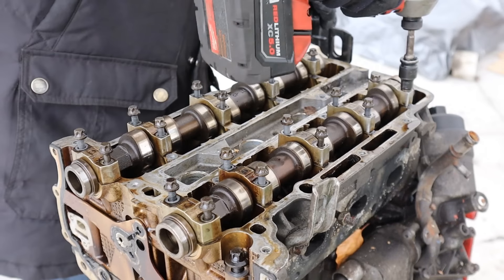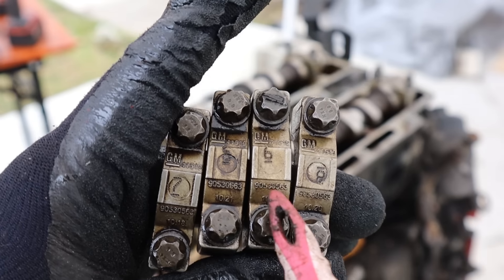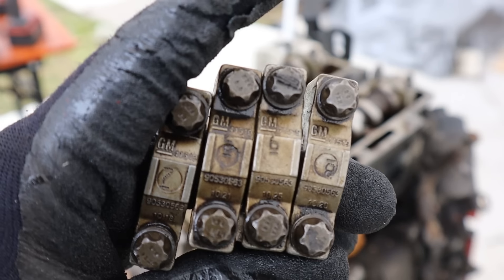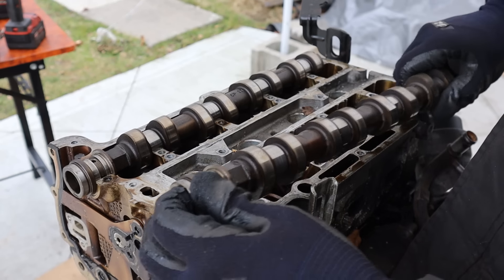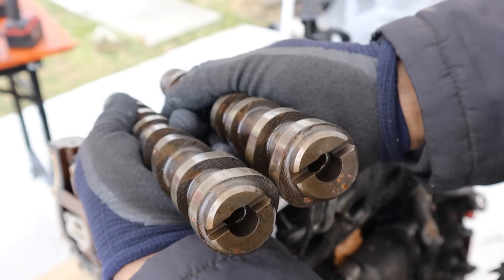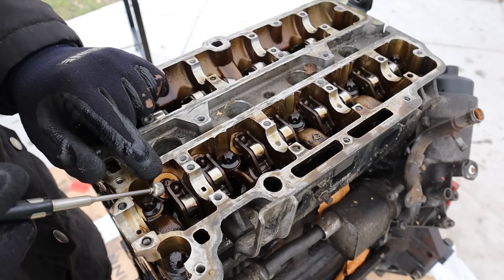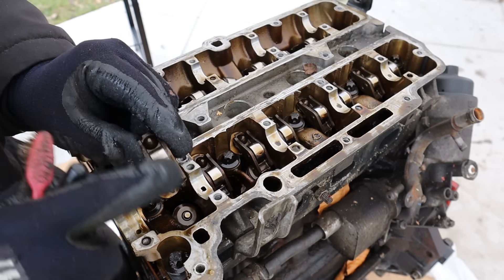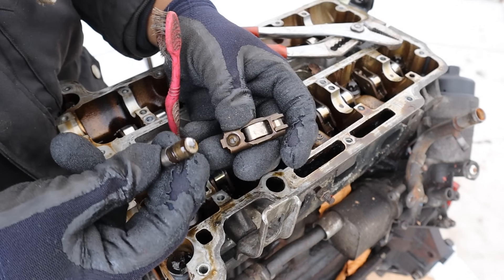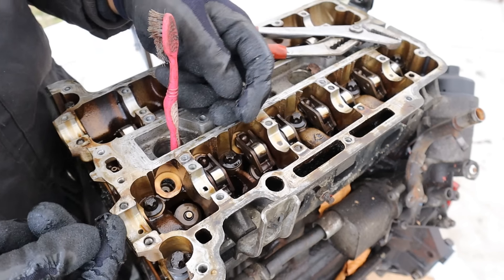Next up I'm going to remove these cam caps. Some of these have a bit of lines on them, indicating that they are worn through from all that coolant that ran through the system. It's interesting that GM stamps all of their little parts, even these little cam caps, with their logo. Now you'll see at the back here — those two slots are for when you're doing a timing job on one of these, and you put the cam holding tool in between there so they don't roll back. In this engine, the camshaft acts on these little rollers which in turn push down on the valves and the valve springs. Behind that we have this little hydraulic piston thing which is pressurized, and that's going to sit inside of here and push up against the camshaft to take away any lash, so you don't have to do any valve adjustment.